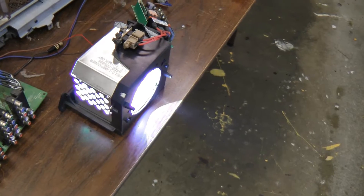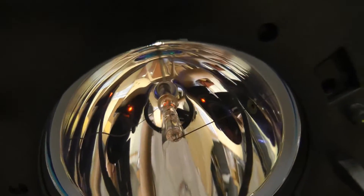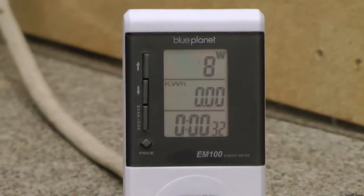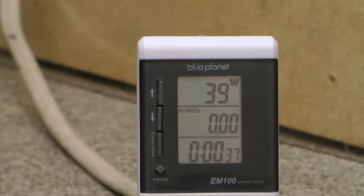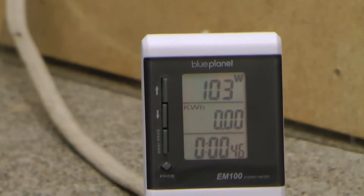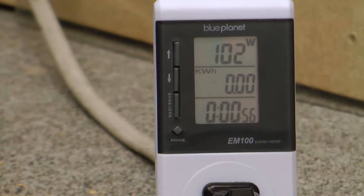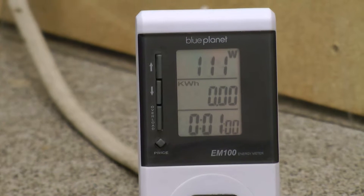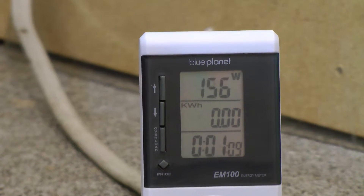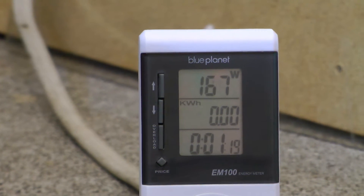And just for completeness, here is the lamp shutting down. The electrodes are cooling pretty quickly. Here is the power consumption of this TV while starting up. The lamp just ignited, so the control circuits took about 40 watts even without the lamp running. And as the lamp warms up, it takes a bit more power — and that's pretty much fully warmed up now at almost 170 watts.